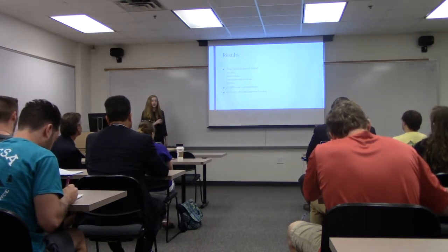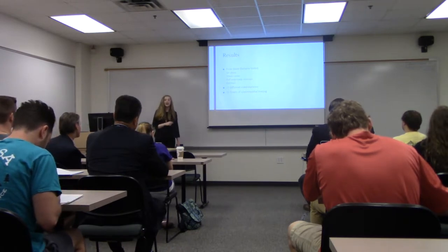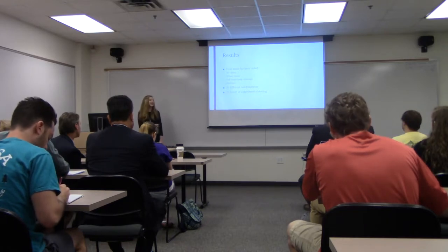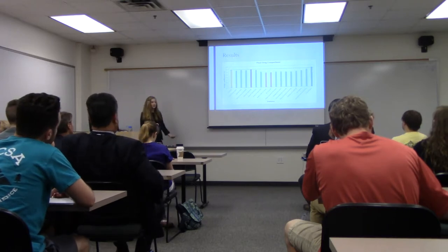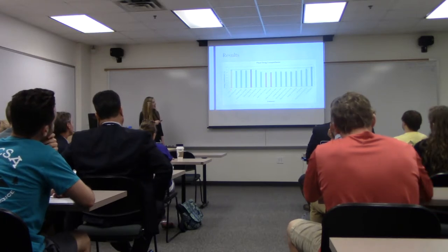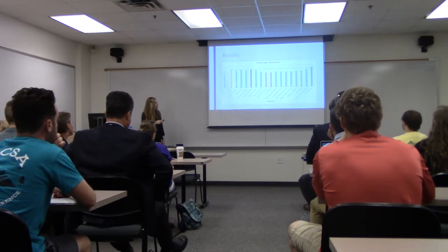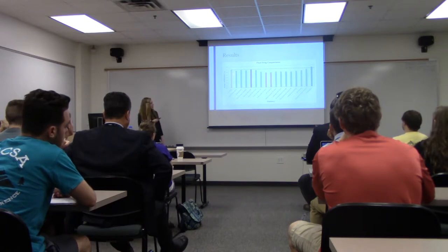So, an overview of the results: I tested four main features: the air dams, wheel covers, full underbody coverage, and fairings. I did about 17 different combinations over a period of about 56 hours of experimental testing. This is a general overview of my data results for drag reduction. As you can see in the yellow here, this is the SUV with no features, and that's a drag coefficient of 0.69. If you look at all of these other bars, all of the features reduce drag, even just a little bit, like you can see at the top here.